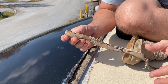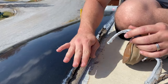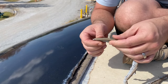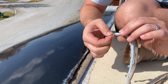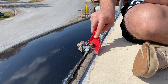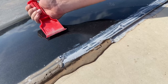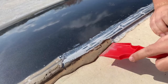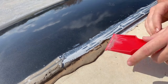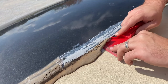This brown color here — that's actually dirt that's gotten embedded into the lap seal, because it's supposed to be this gray color. When you're going through and scraping all this off, it doesn't have to be perfect. You just want to make sure all this dirt color is off because the new lap seal won't adhere to it — it's not sticky. Whereas if you get to this side, it's sticky and tacky. So you want to make sure all this brown stuff is off. It comes off pretty easily, just scrapes right off. Just like scraping from the painted surface in, you also want to work from your roof in as well. Because if you just go straight along, your roof will start to bubble up and you can put holes into it. So it's best to work it to the edge and then come back and gently scrape along and it'll lift right up.